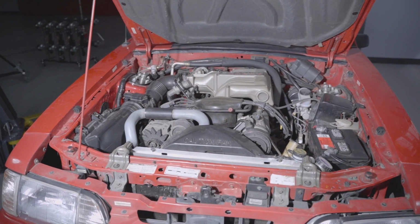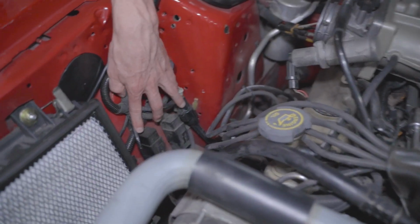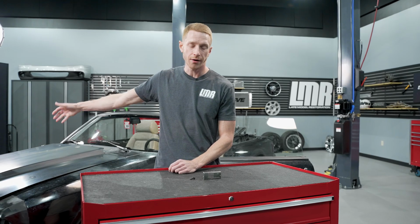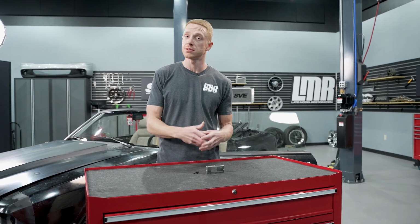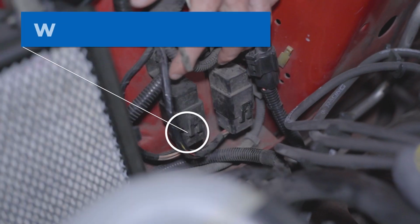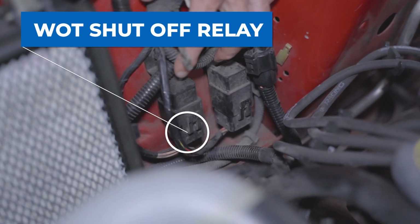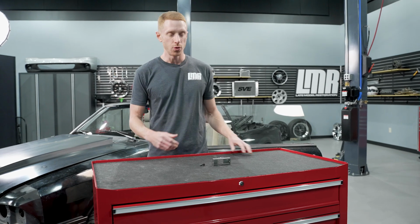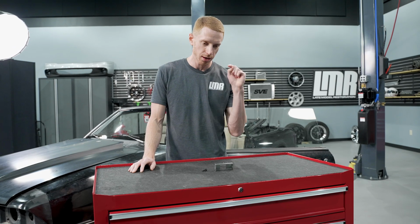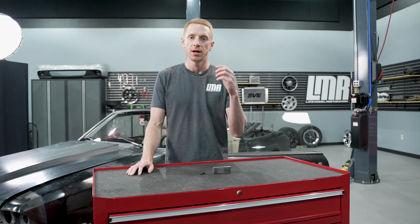And then if you wanted to check, you could look under the mass air meter in the engine bay in front of the passenger side strut tower, and you'll either see one relay, which is the wide open throttle cutoff relay, or you'll see two relays. One is the wide open throttle cutoff relay, the other is the fuel pump relay. Speaking in terms of all of that, if you want to know more about the fuel pump relays and their locations, I'll link our detailed article and the video down in the description.